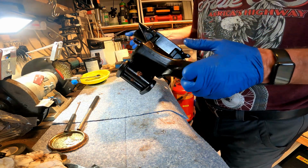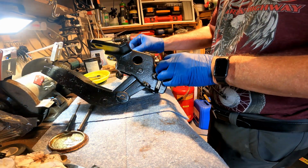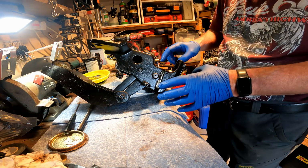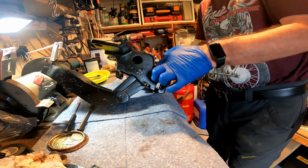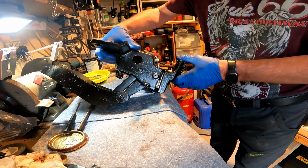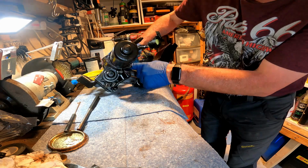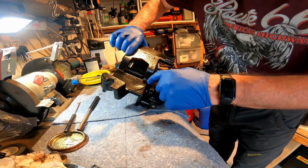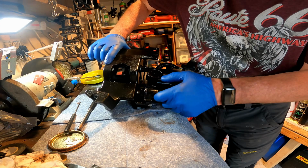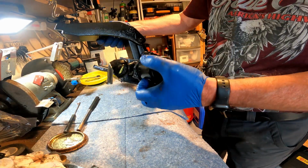So I'm going to take that away and bring the other one in. So this one is obviously the one with the motor on it. I didn't want to take that out here because it meant taking the whole motor off, but I can see some areas where maybe we could just put some lubrication in there, or protection here at these points here, and at the other side. On the other side of the motor area, obviously the lubrication's inside the motor in that shaft that drives that, so that's why I didn't want to take that out. So I'm assuming that the motor's driving a gear and turning that shaft, which is locked in there with the pin. And we can't move that now because it's obviously locked in there.